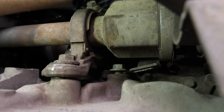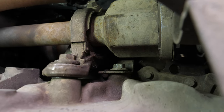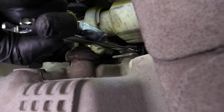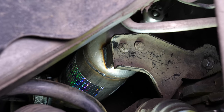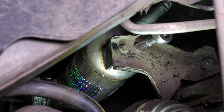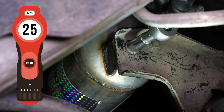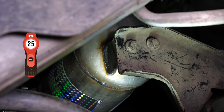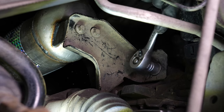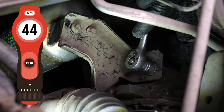Then put the stand on the belt side back in place, first by sliding it into the screw behind the drive shaft, then by screwing in the two catalytic converter screws using a socket wrench and a 10mm socket. Then the engine screw using a 13mm socket. Finish off the tightening with a torque wrench.